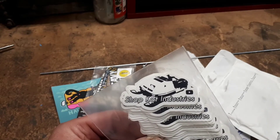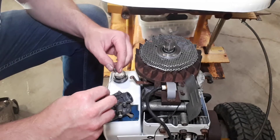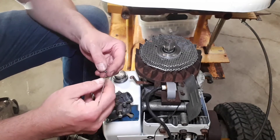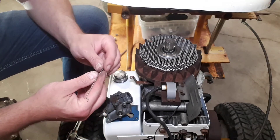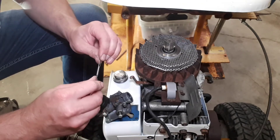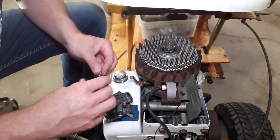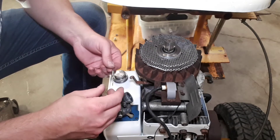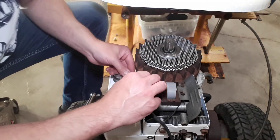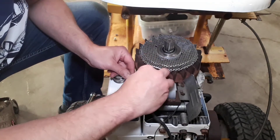They do look excellent. Awesome - time to get to work. I was being a little optimistic before when I said the carburetor was not coming off anymore, because to get this linkage on you pretty much have to take the carburetor off just to get this one linkage in. The rest of it is easy, but just this one. So yeah, here we are.